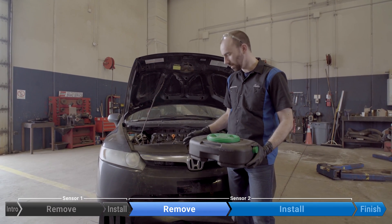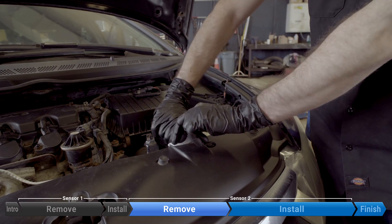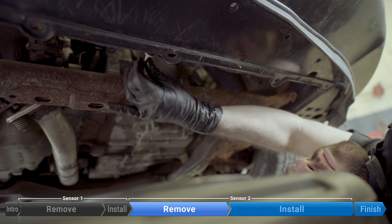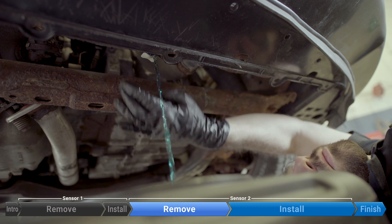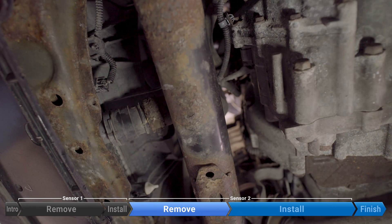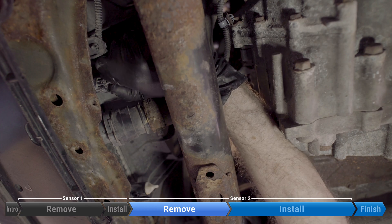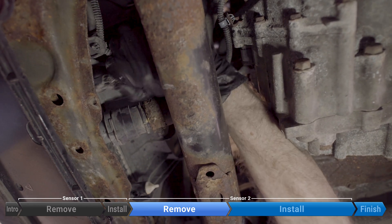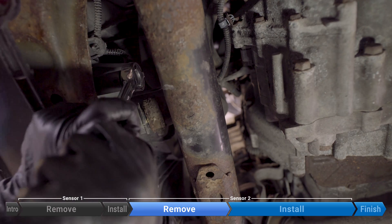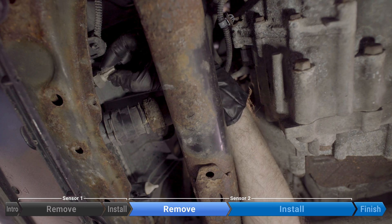Where ECT2 is so low in the system, right at the bottom of the radiator, you've got to drain the entire system or you're going to make a huge mess. This could take a while, so I'm going to take a break. This is coolant temperature sensor number two right here. First we'll disconnect the cable by squeezing the tab and pulling. Now we take a 17mm socket, slide it over. Watch out — a little bit of coolant could come out here. And there it is.